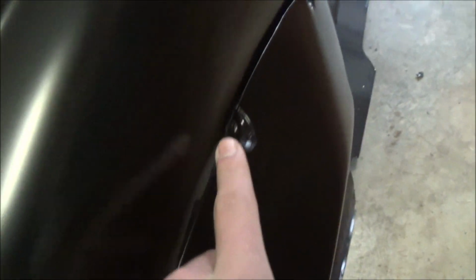So I put that flare back on, and I just want to take this time to show you something that you'll probably run into if you have a kit like what I'm doing, where I'm taking a kit that's meant for another car and putting it on mine. Especially if you have fiberglass, you could work this out with ABS, or if you have a plastic or something that you can mold with a heat gun. A lot of times you're going to get these gaps right here. I don't know how well you can see it. There's not a huge gap, you may be able to see it a little better up here, but there's a gap between the actual flare and the body itself. With a lot of finagling, you could use fiberglass to reshape your flare a little bit, to get it to the position that you want.